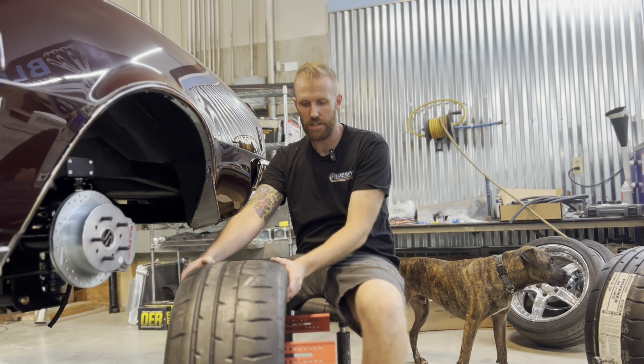First things first, I have the tire jigged up on our CC Tech Wheel Fitment tool. These aren't cheap, however the price of this is great insurance if you mess up a set of very expensive tires, so we're going to use this tire tool every time. A cardinal rule in car building is mock up everything — it's kind of Murphy's law. If you don't mock up something and think it's going to be okay, it's going to come back to bite you. The more redundant on mock-up you can be, the better off you'll be, because on final fitment we're going to get a wheel that fits the car perfectly.